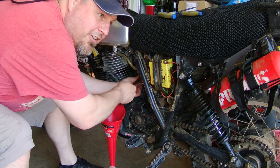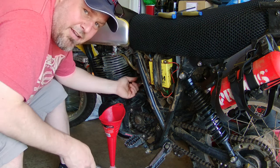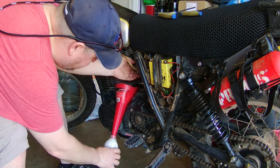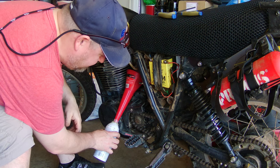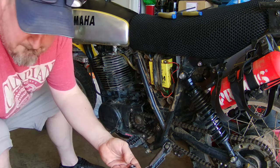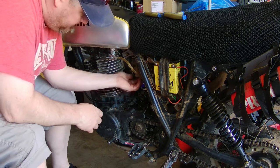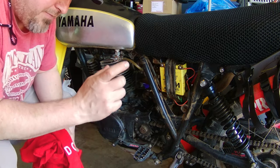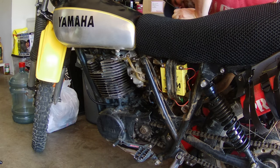There's a big drain here, and it's kind of an old-school thing, but it really allows easy main jet changes because you can access a big screw here. Basically I'm just loosening it with my finger - we're going to let that drain down. That right there is the drain. So we've loosened this clamp up and I've got to get this carb off. What I'm going to do is take off the short boot to get more room.